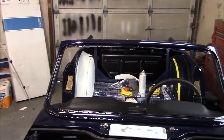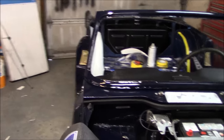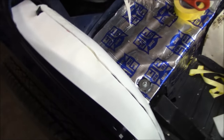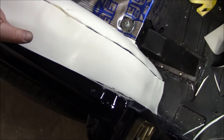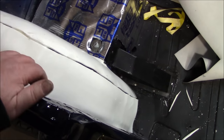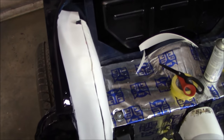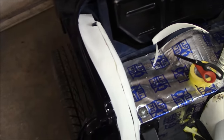We've got the foam glued to the wheel arches. Now we'll lay the bead in the groove and glue it down, working along the groove line, making sure the bead fits directly in the groove. Then we'll stretch it from left and right, pulling it across to the side of the car and down to the floor, making relief cuts in the vinyl as required. I've already glued the top edge and we'll start laying the cover in at the top.